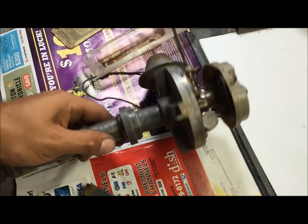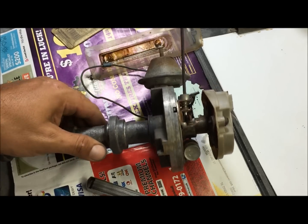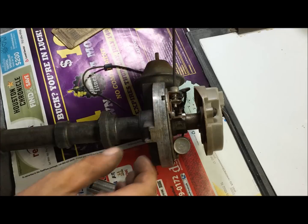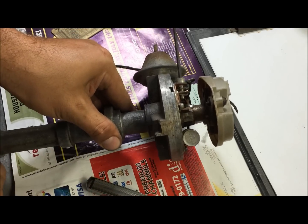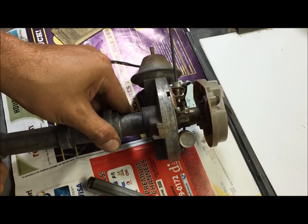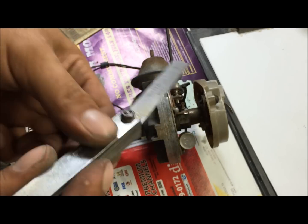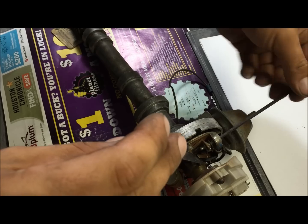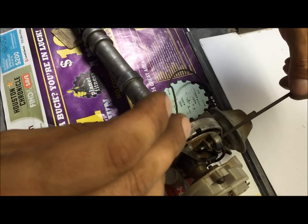Okay, if you're messing with an old distributor, make damn sure you clean those points, but you want to put new ones in there. But if you're doing an old distributor, you gotta sand those points and clean them up and then look at them. Open that up and look at them. Okay, now we got that cam at its highest point. Get it at the highest point. Now I'm gonna do 16 thousandths. We're just sliding this in there until we get some resistance. Okay, got some resistance.